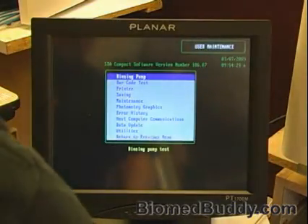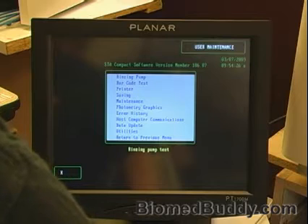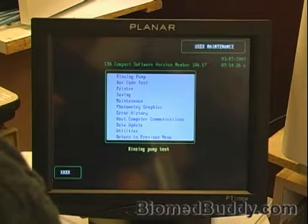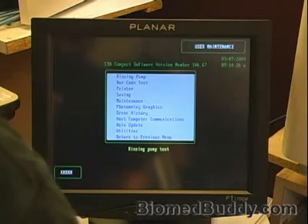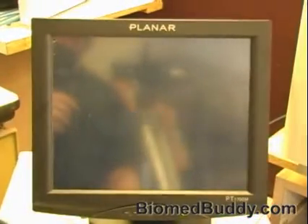Here's the user maintenance screen. Hit Alt F10. My code for today: bring the first number down — zero. The second number goes to the right, and the third number goes to the left, so the next number is zero. Then three, seven. Figure out the last two numbers: sixteen goes into twenty-one once, so the first digit is a one and the remainder is five — giving me one and five. That should get us into the service menu.